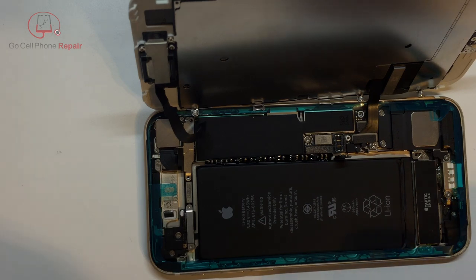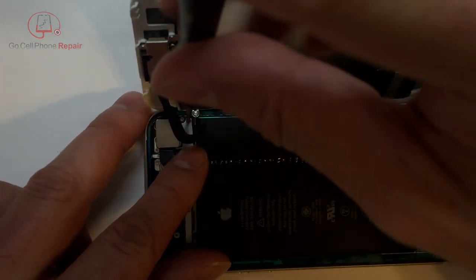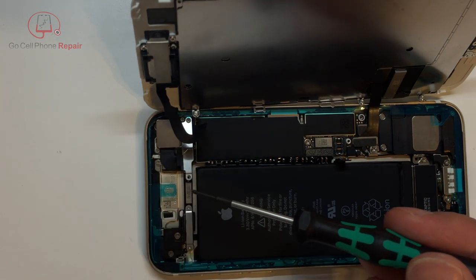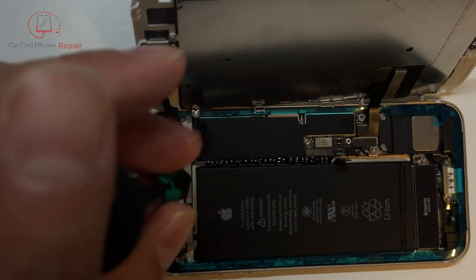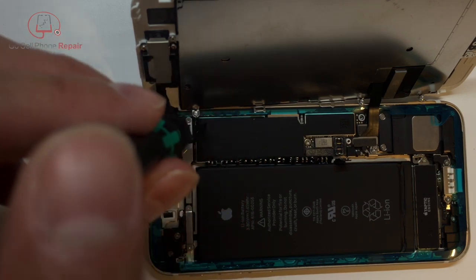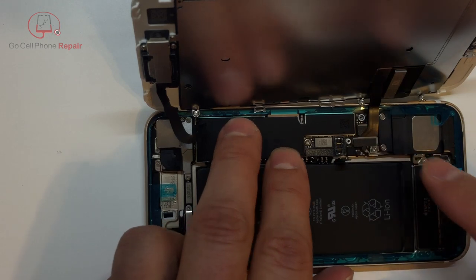But once you do, as soon as you get one of these screws started, and I don't recommend you tighten them down, you know, they're never really gonna be torqued very hard, but you wanna just get this threaded and not even finger tighten it yet, because that way we can move this thing around if it's not lined up straight. Anytime I'm working with a panel, if it has two or more screws, I like to get all the screws just threaded. And once you do, then again, you can just finger tighten. So these, you don't want to put super tight by any means. You just want to turn them until you feel it stop, and then you're done. And that is especially true of those tri-lobe screws, because they are a pain once they get stripped.